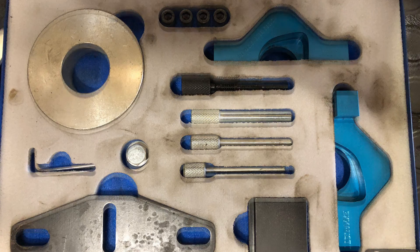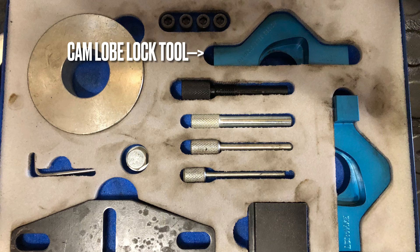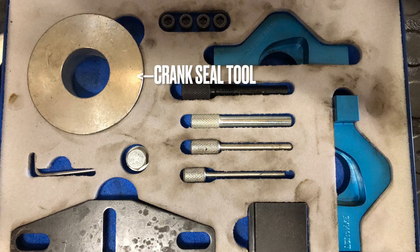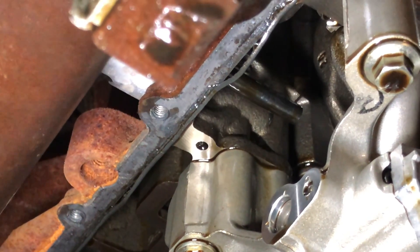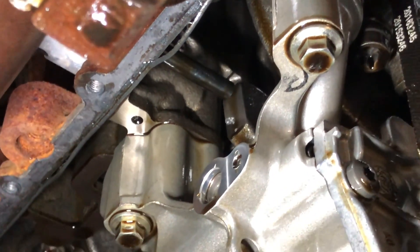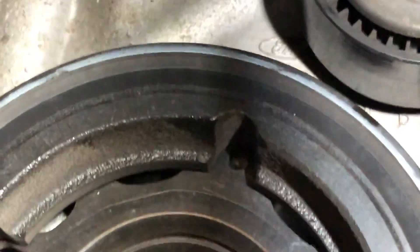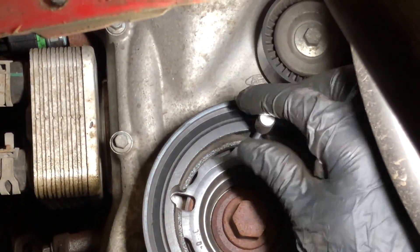Here's a breakdown of all the tools in the kit. The crankshaft locking tool fits in here and when the crank is rotated it locks up like so. Then the crankshaft pulley has a little hole just here and the pin locates to lock the pulley.